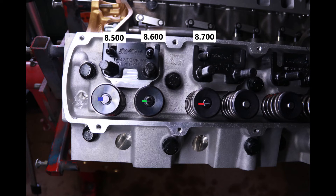The 8.600, shown in green, is a pretty ideal push rod length — it's centered on the valve and produces a narrow strip of travel. The 8.700, while still a small pattern of travel across the valve, is definitely not centered and therefore less ideal than the 8.600.